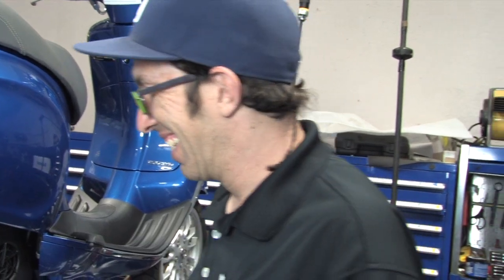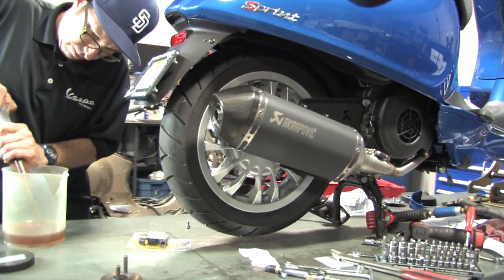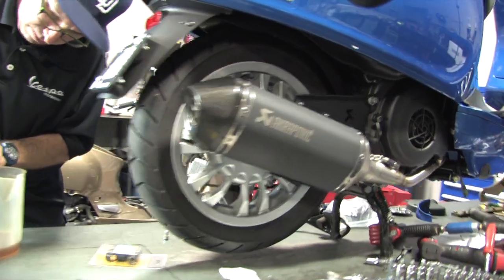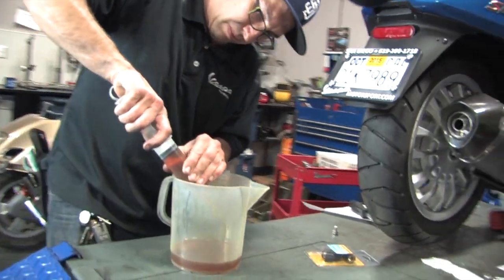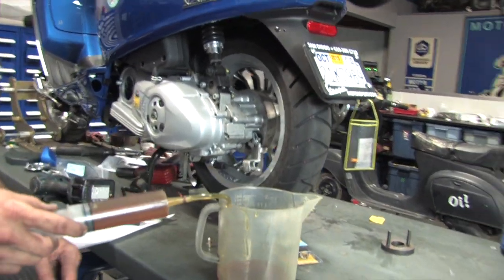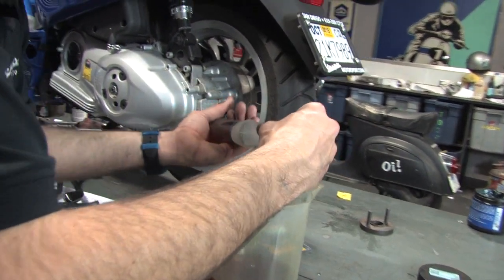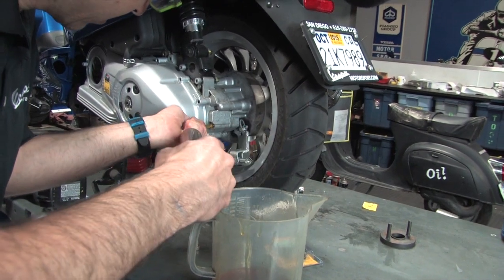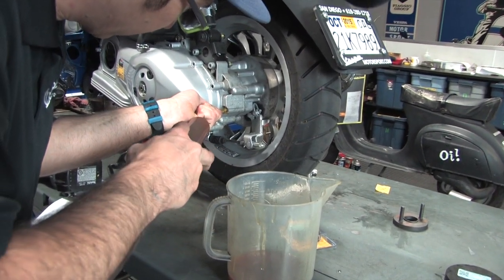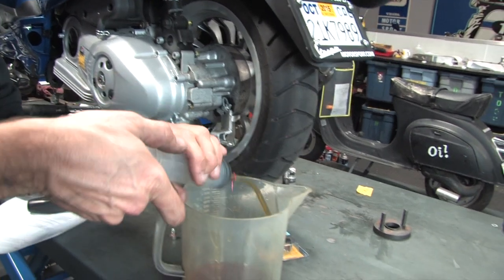Instant 10% overdrive! Robot's already got the rear tire installed and the exhaust back on. The one final thing often missed in a normal video — he's topping off the gear oil. It's going to take about 300cc. Since the gearbox was completely disassembled all the gear oil drains out, so it's actually a higher capacity than when you're just flushing it. Using a syringe with a little tube, you can get it right in the hole — there's 100cc.